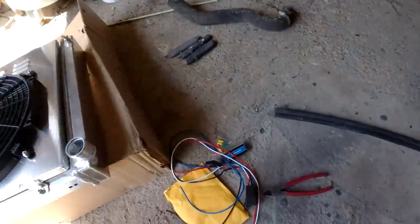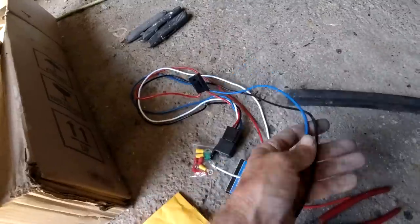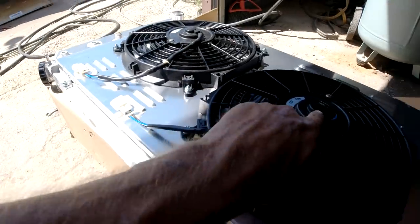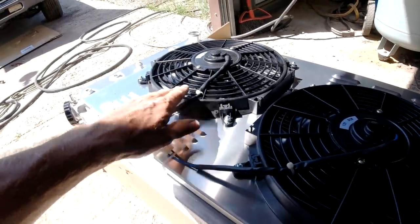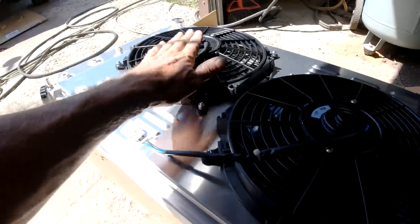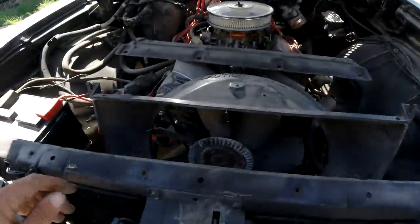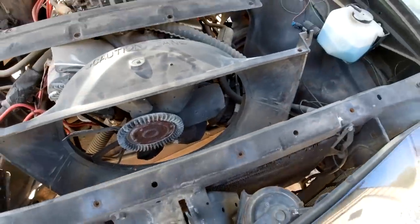And they didn't give the right wiring connectors either. They give a fuse and a relay, but there's no connectors. They give these little round ones, and what you need is these square ones. But I got some stuff there, so I run the wire, because this is about an inch from the fan. I'll show you here in a minute. So yeah, just any little slop in that's gonna hit the fan. So we run it up top there, and we'll run some wires out to this battery. Okay. Well, I'll be back in a minute.